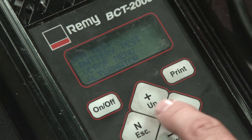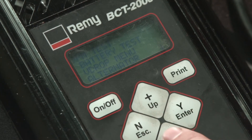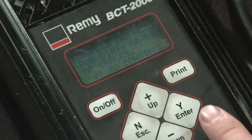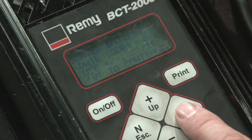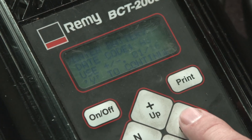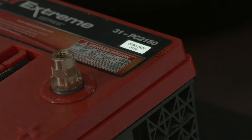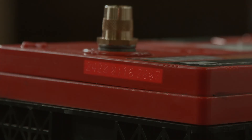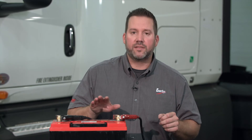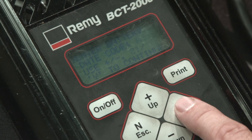This tester gives you several different options of what to test — you can do a battery test or an alternator test. Obviously, we're going to choose a battery test. It also checks items like making sure the cables are connected properly and that there's no dirt and debris. A nice feature of this tester is it actually asks you for the date code of the battery. The date code on an Odyssey battery can be found in the upper right-hand corner of the label. If the label is rubbed off or missing, you can find it on the side of the battery where it's etched in. In this case, this battery was built in January of 2016, so that's the information we're going to put in.